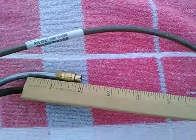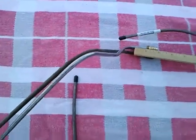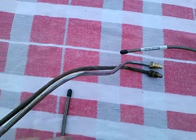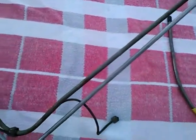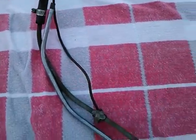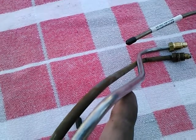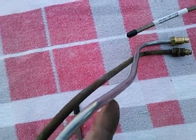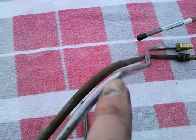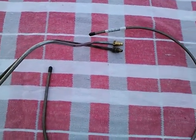Not wanting to try to straighten this round line — and it's the wrong color and it's got writing on it its whole length — I bent my own brake line to match the shape of the stock pipe, actually off of another engine. I've got that stock shape now in the brake line material. I added a bend here to go around the heater pipe, and I came up a little higher here — maybe more than I wanted to, but I wanted a little more clearance for getting that number 3 spark plug out. This didn't take very long and if I have to do it again, it won't be the end of the world.